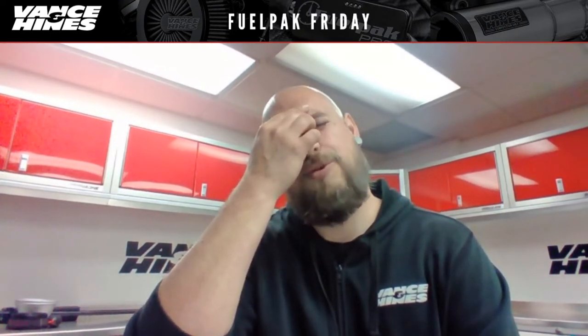Outside of that, take a look and see if anyone has changed something like an XIEDs, which is basically a tool that fools the ECU to dump more fuel. Those are pretty inexpensive, but they don't work all that well. The other alternative is it could have a native flash in the ECU from Harley Davidson. The only way to tell if that were the case would be to take it to a dealer, have them plug a DT2 into it and see if it picks up. That being said, I can't remember if a DT2 will even plug into an 03.